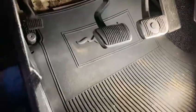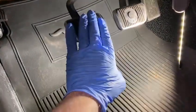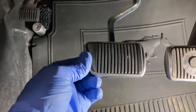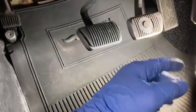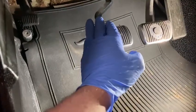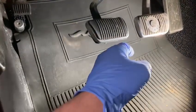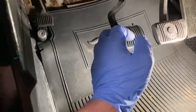I just started the car up, and using my foot pressing this way as I'm pressing down, it doesn't move a lot. So if I press it that way and down, I can get it in all five forward gears and reverse — no problem at all. But I've got to press the pedal all the way to the floor. If I sort of naturally press my foot this way a bit, it hits the bolt.